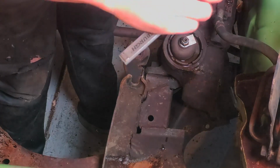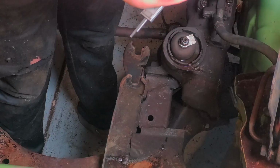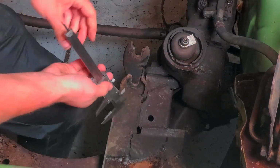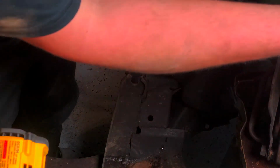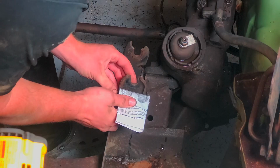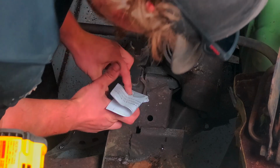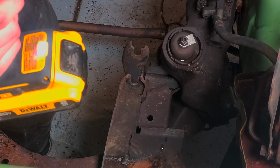Alright, so we're just going to take our calipers and I'll walk it at an inch. Not rocket science, you don't have to be exact to the 10,000th. And then we're just going to measure down and mark. That should do it. Compare it to the printed to scale version. We're looking close enough, so now we'll just grab a small bit and get a pilot hole started.